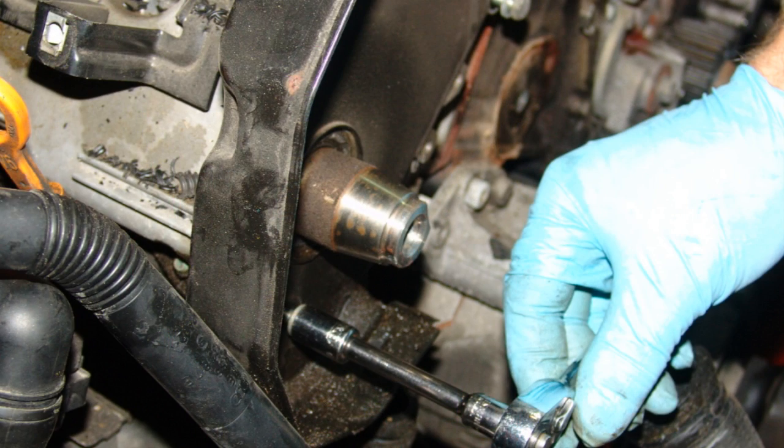Remove the camshaft bolts and pulleys. Be sure to keep track of which pulleys belong with which side. Using a 10mm socket wrench, remove both rear timing belt backing covers. Remove the old camshaft seals one at a time using tool 3240BL.